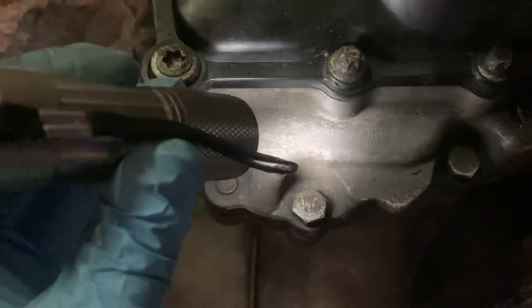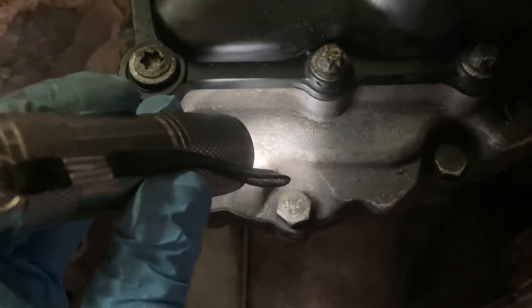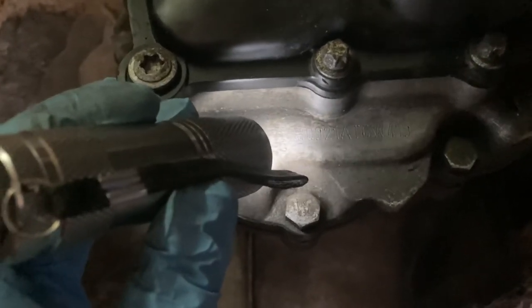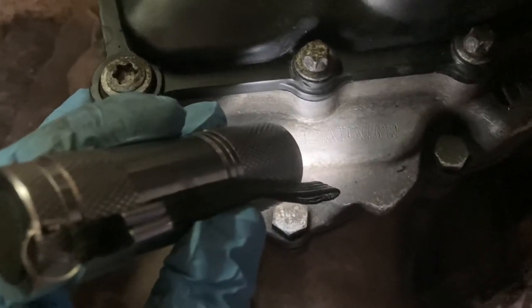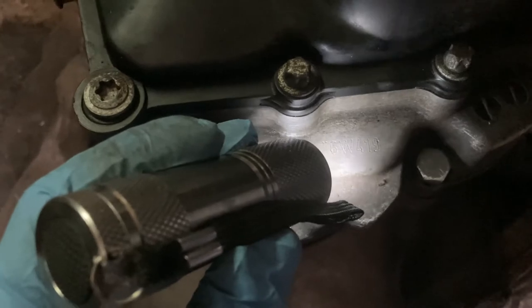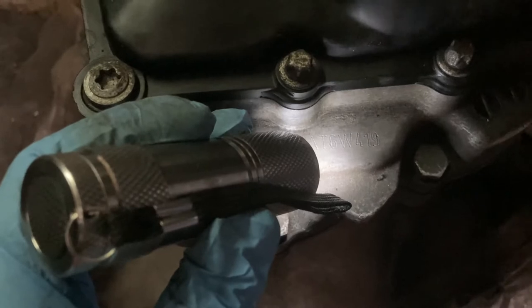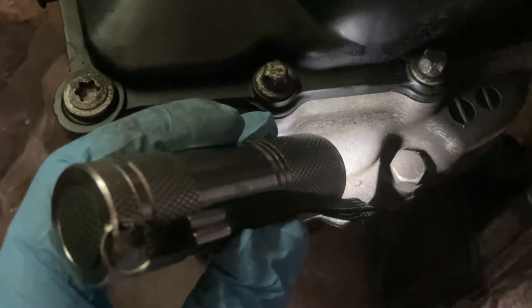The box we're going to take down from the car is an 'A14' because the car is from 2014. The serial number is difficult to read on the installed box, but the code is 87C419. '87' together with 'C' indicates the close-ratio gearbox, but it has the same final drive of 4.19 to 1.